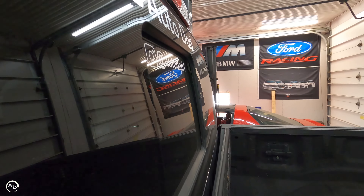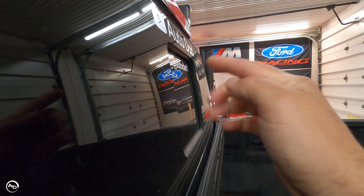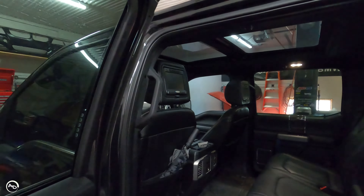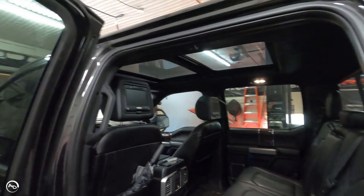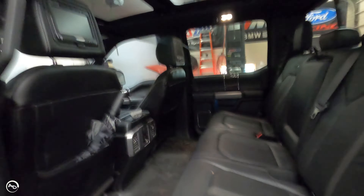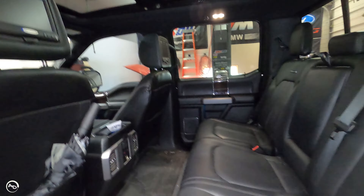There's a gap because the window is falling inside the truck. A little while back, I started hearing a whistling a couple of weeks ago coming from the back. I thought one of them door seals must be bad. So I got in here and I'm looking around — no seal's bad. I thought it might have been the panoramic roof. Nope, that looked all good. Finally, it got really bad one day and I'm like, what in the heck is that? So I climbed back here and it's the window.